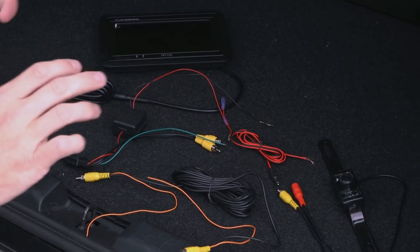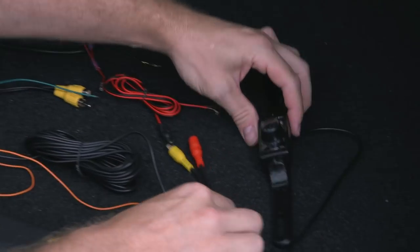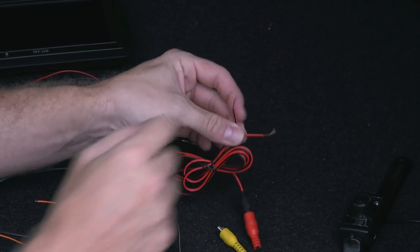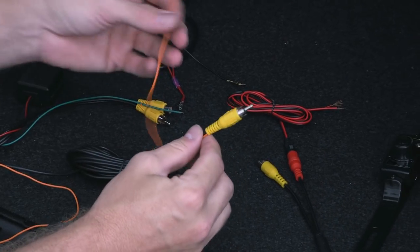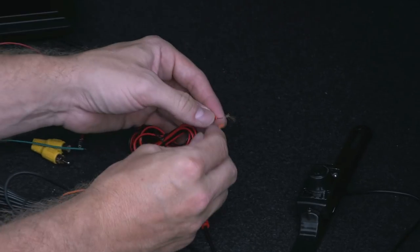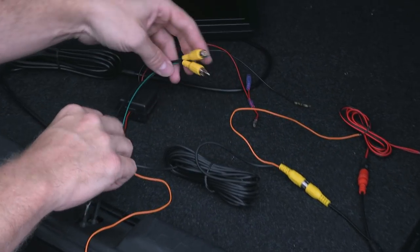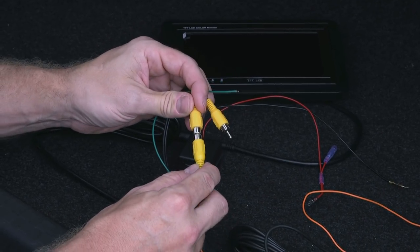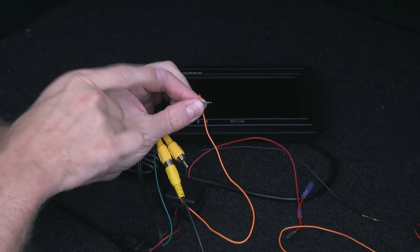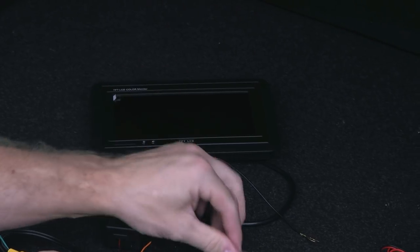To make it a little easier, we'll configure the system on a simple layout so you can get a better understanding of what goes where and how the connections are made. If we have our camera installed, we would connect the DC power connector — positive side to the reverse light, ground grounded at the vehicle. Then we would have our RCA video cord, make the RCA video connection at the back of the vehicle, and connect the orange lead to the same place that powers the camera. This way we send the trigger signal all the way to the front to the monitor. Up front, we would make the same RCA video connection, connect the trigger wire from the back to the front monitor trigger wire, connect the positive side to power the monitor, and then ground the monitor.